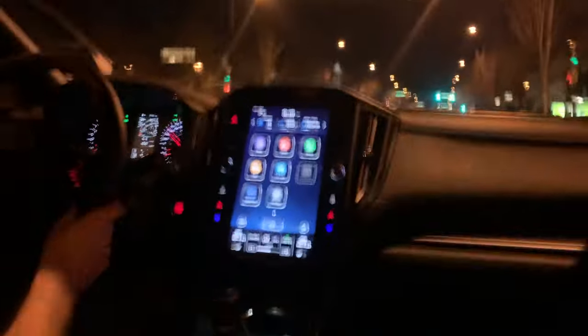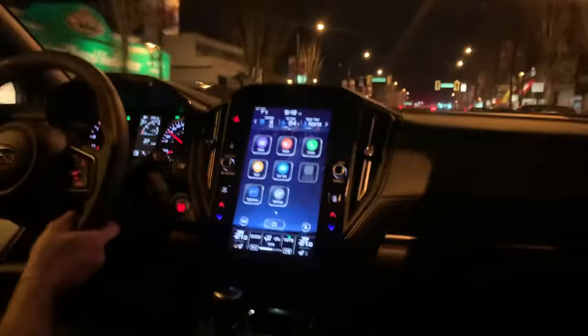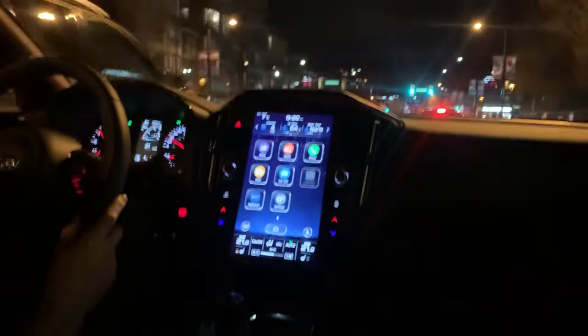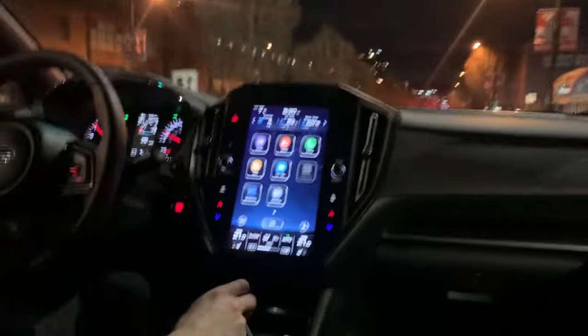The Accessport really livens up the car. I'm purposefully trying not to stress myself out monitoring parameters. I've used Cobb's parameters for fuel and kept the car mostly stock — with the exception that I removed the charcoal filter, but kept everything else stock including the airbox and air filter. Other than that and the axle-back — which Cobb says is fine — it's essentially stock. With the 91 octane map, I feel it's conservative enough that I don't have to monitor things all the time. I love not having to drive it as hard to enjoy the same power.